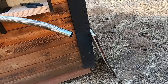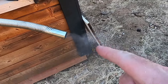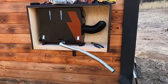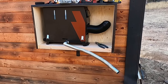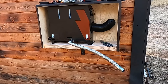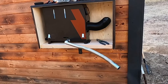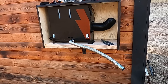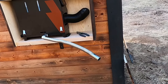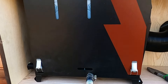Okay, it looks like it's burning off a little bit of diesel — this is why I mounted the heater outside. What's happening right now is the glow plug is heating up, and then once it comes up to temperature the fan will kick on and it'll start blowing hot air into the cabin with hot exhaust out the back. I can hear the pump ticking.